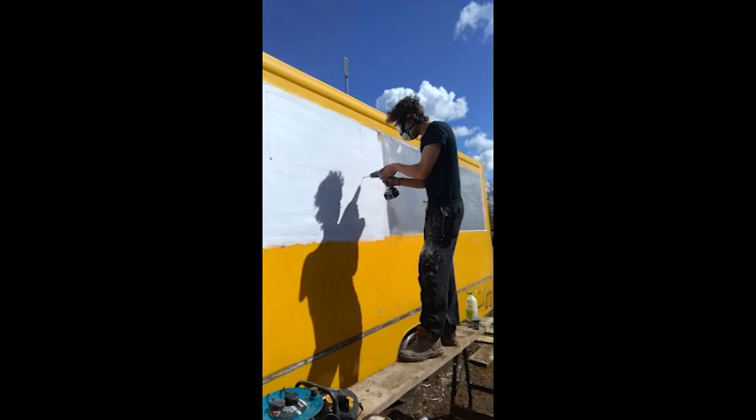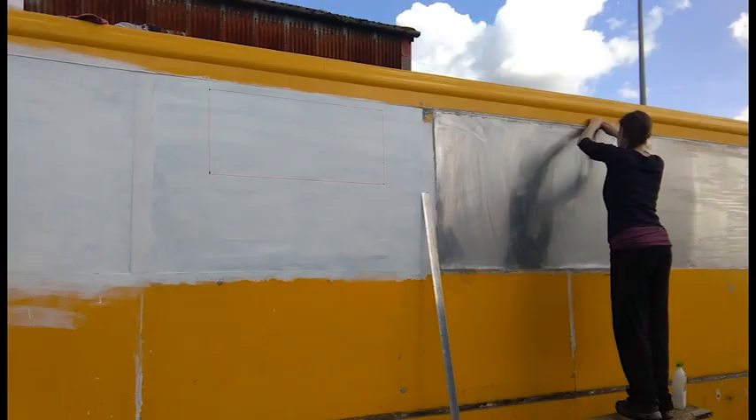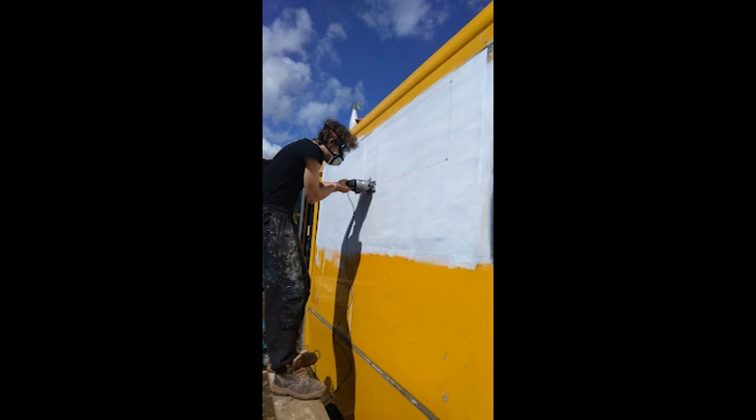This is then setting out for the windows. Obviously all the panels are in, we wanted some light coming in. Basically set out on the inside, drilled some holes through the corners, and then projected that onto the outside. Made the drill holes bigger so that you could connect all of the holes and know you're gonna get it through in the right place. Then I just took the jigsaw with a good metal blade on, and PPE, cut the hole out. I was pretty excited about that.